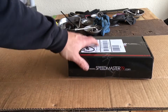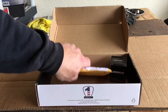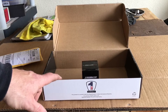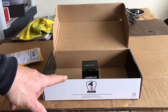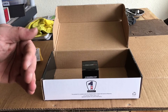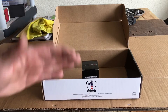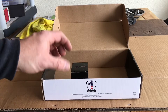I wanted to show you guys what I got in the mail today, because I've been having all these problems tuning this thing. I ordered a Speedmaster non-liquid-filled fuel pressure gauge. We found out years ago back in the 90s that you don't want to run a liquid-filled gauge inside your engine compartment, because the liquid actually changes viscosity depending on under-hood temperatures, and you'll get inconsistent fuel pressure readings.